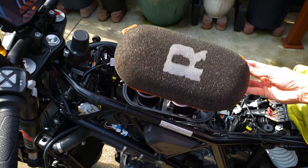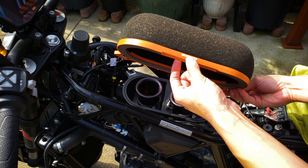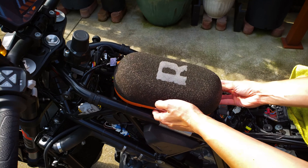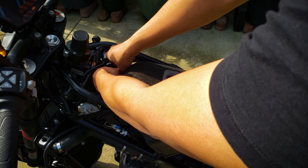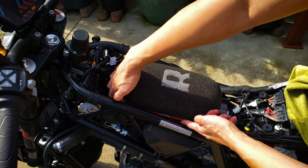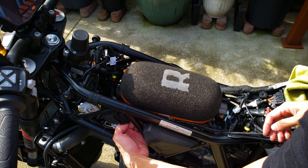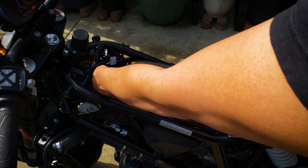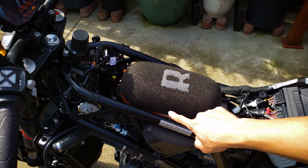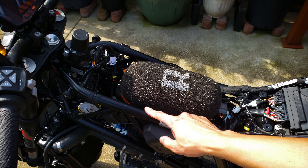After oiling the filter, we'll go back and install it. There is a hook on the left side so make sure that goes into the base — it's not supposed to be flapping around. Check if the other side is flapping around — it's not, so it's hooked onto the base and secure, not going anywhere. I also cleaned the orange foam base of the oil so that when you touch it, it doesn't get on your hands.